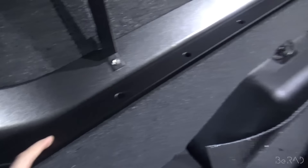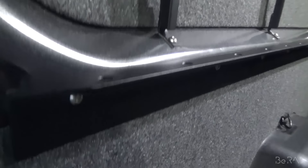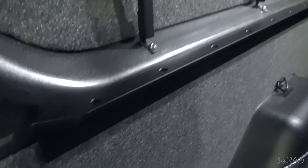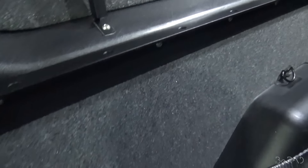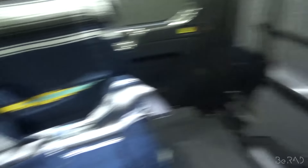The other thing, also covered in part 6 - these angles here. Lots of bolts holding those on. Quarter inch thick, really rigid. Hole every 6 inches to put tie-down hooks through. You could bolt a bed onto there or a shelf to go all the way across. Got these boards as well, which have also been covered. Behind them is the bagged fiberglass insulation stuffed into all the holes, which gave a lot more insulation and definitely quieted up the vehicle a lot.